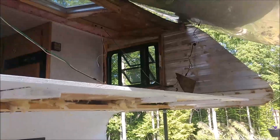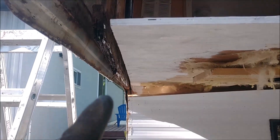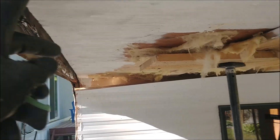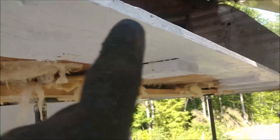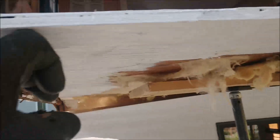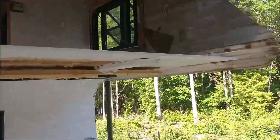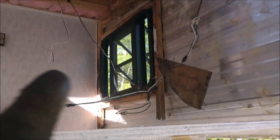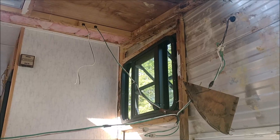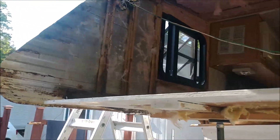I still have some wall pieces up here to make, but that should be fairly easy. I've got pretty much all the pieces made for the whole nose — just waiting to get in there. I'm going to work my way from the bottom up, starting down here putting the brace and support pieces back on to hold this bed up. While I was at the hardware store, Brenda was kind enough to paint this piece to seal it up on the inside and outside. It's still really solid — glad I didn't have to replace it. I'm confident I can make it actually stronger than it originally was. They used staples when they attached the pieces of wood together and those staples just rotted right out, probably from condensation.